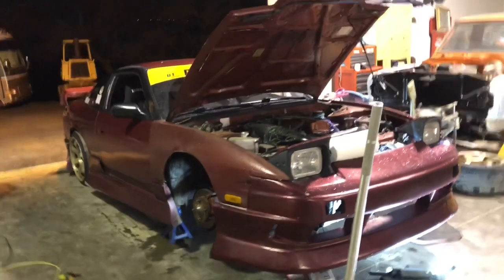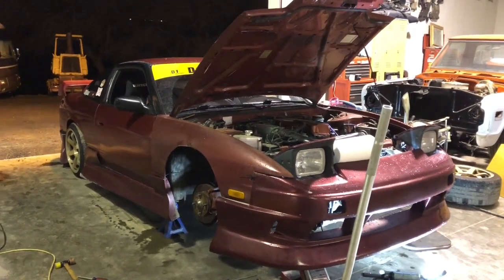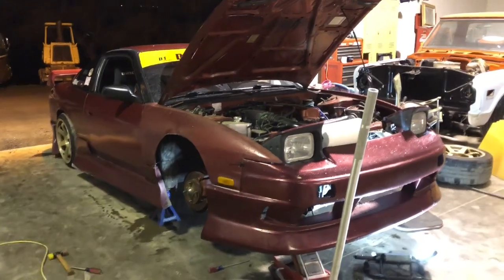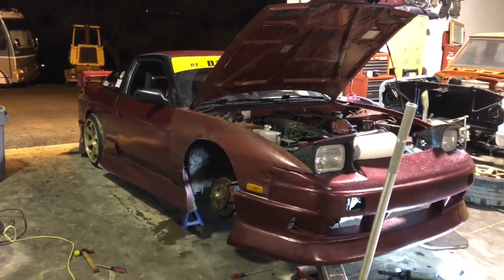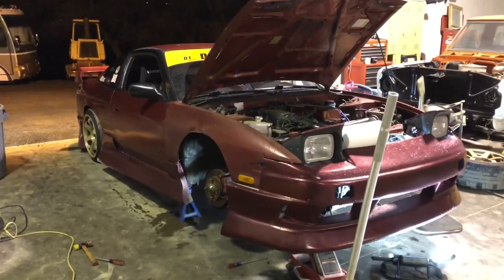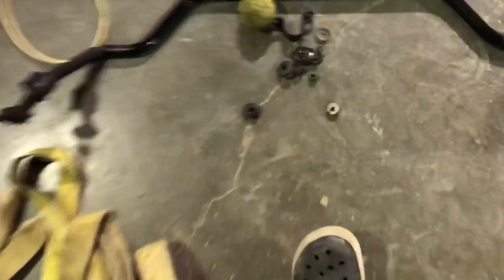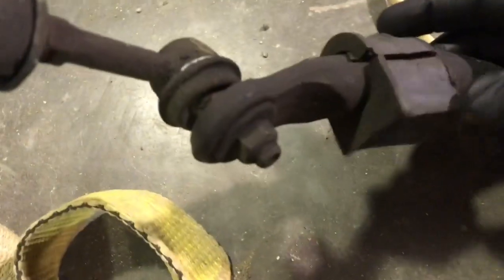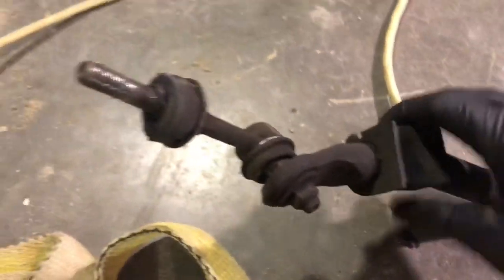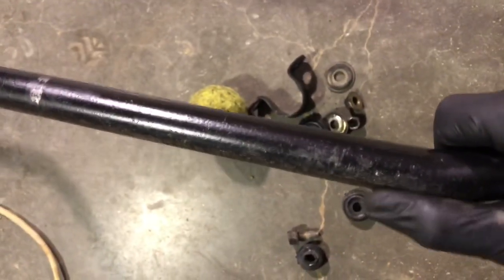I started to sort the sway bar out, got the actual sway bar bracket off the frame so I could get the bushing repositioned and get it all buttoned back up. Then I looked across it and realized this thing has been dragging for like the last four and a half years basically — it's almost half the diameter it should be. All the bushings, rubber, end links, everything are blown out. People have been telling me forever to just pull the sway bar off and it'll feel way better, so I just did that instead. The rubber on this thing was absolutely gone, the bushing is all beat up, missing the ends, really soft and messed up. End links are super packed out — you can actually see the carnage, this thing's got a pretty good flat spot to it.